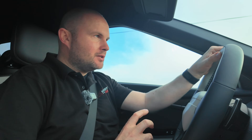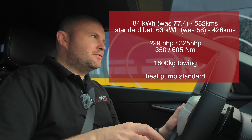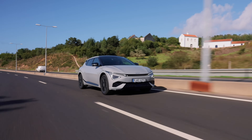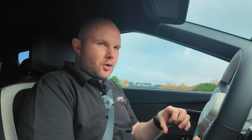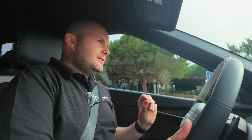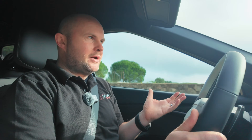Kia are now into their fourth generation batteries. They've managed to get more range and a slightly increased battery size out of the same physical size — every single cell is more energy dense. The range has increased quite a bit. In the past, the EV6 would slow down at around 80% state of charge to check the health of the battery, taking a couple of minutes, before speeding up again. You don't need to do that in this latest version — that slowdown at 80% is now gone.